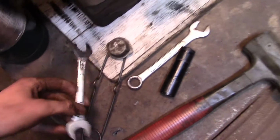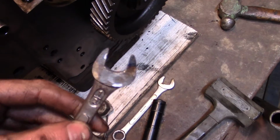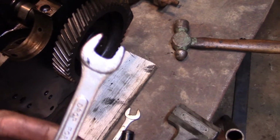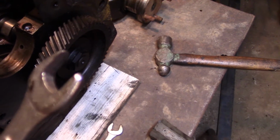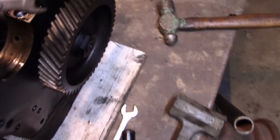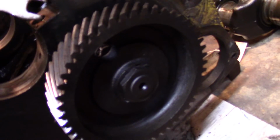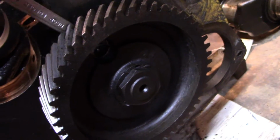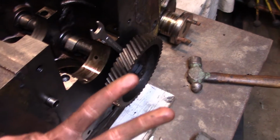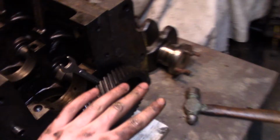First I tried modifying my 1/2-inch wrench, but this 1/2-inch wrench is about 520 thousandths, which was too big. So I had to take this 12mm wrench, file it a little bit larger. I'm not sure what size it is, but it's a little bit larger than 12mm, which is 475 thousandths or so. Sneaked it in there, got it on the head, and I had to do 2 different things that people on my Harbor Freight Wrenches video said is an absolute no-no.